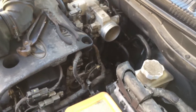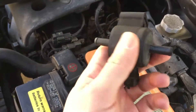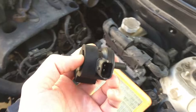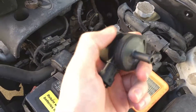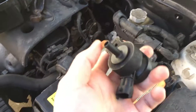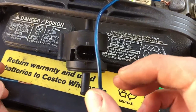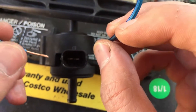It's a very small part and very easy to get to on this car. The other part I'm aware of is under the vehicle and might need replacement also. When I was changing the wheels to summer tires, I noticed the area where that other sensor goes is all rusted out — the bracket holding the sensor in the back is rusted through, so there might be an issue with that sensor as well. We've got the negative and positive battery terminals connected — just listen for the click.